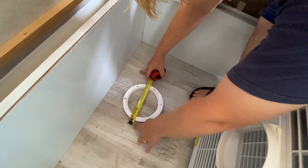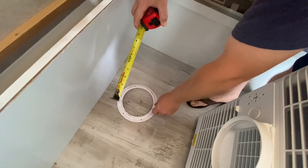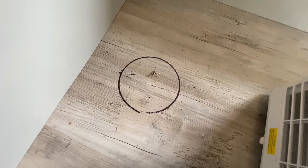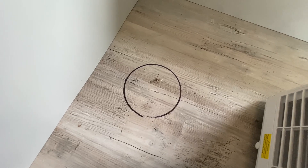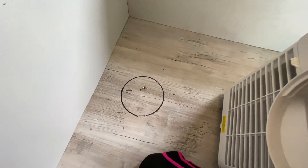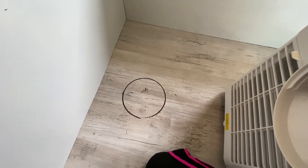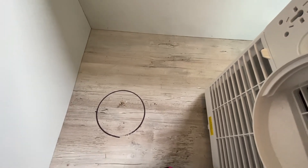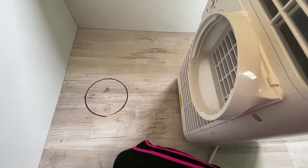Yeah, the beam is too close. It's gonna have to go right where that little drill bit is at. He said I could come over a hair more this way — let's hope we don't hit the beam on the trailer. So this part we're gonna cut out from the inside. The hose is gonna connect on the back here and go to there. Then we'll have the panel come out probably about here — basically this whole back area is gonna be open. And then we have our little brackets to hold the air conditioner in place.